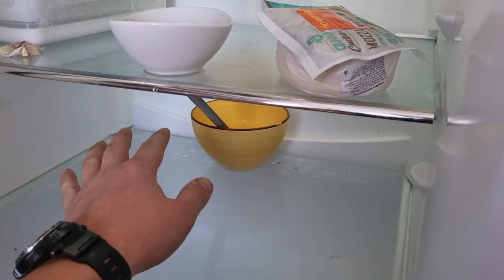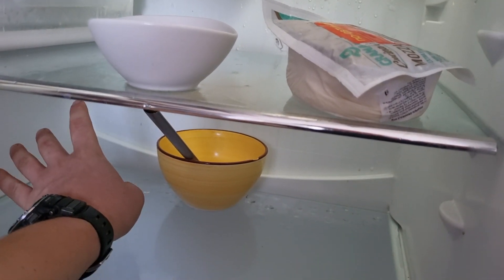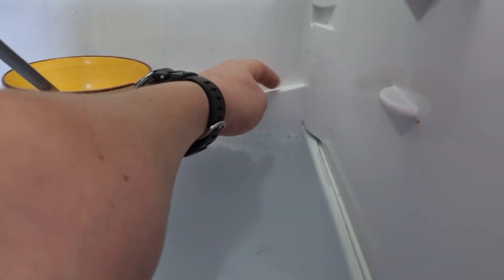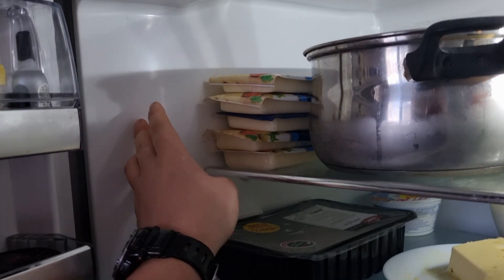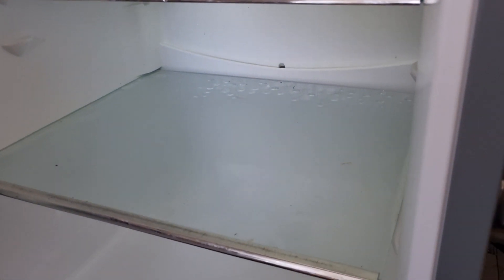The first rule: nothing should be touching the back. Especially like that root you saw, which was actually dripping down. It could also be something else — an internal problem with the seal of the fridge — where water condensates and comes from the side down. But this one is definitely a problem with the back, and as you saw, it was dirty, so that was the main reason it was overflowing. I hope this video is helpful and I'll see you on the next one, bye!